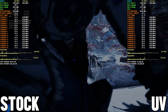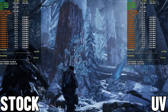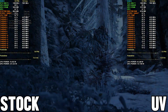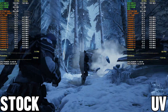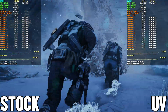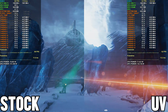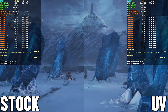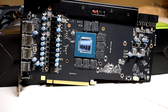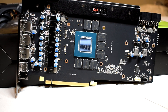Circling back to power usage, let's take a quick look at Gears 5's benchmark running on the RTX 3060 Ti. On the left is the stock configuration, and on the right is the undervolt. Here, you'll see a dramatic difference when it comes to GPU power usage, where on average we're looking at a reduction of around 80 to 90 watts. Meanwhile, in terms of a performance hit, we're seeing a loss of around 4 to 5 frames per second. I will also be making a couple of follow-up videos showcasing more gaming benchmarks like this for both the 3080 and 3060 Ti, so be on the lookout for that. In my opinion, this is a great trade-off — I'll sacrifice that negligible performance any day if it means saving that much power and seeing considerably lower temps. This also just goes to show just how far Nvidia decided to push the silicon to its limits to get out every last bit of performance from these GPUs. We're just spending a couple of minutes in Afterburner and it reduced power drastically with a very minor hit to actual performance.